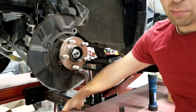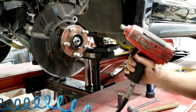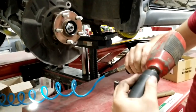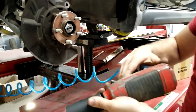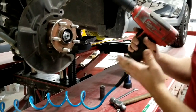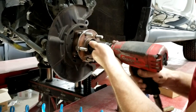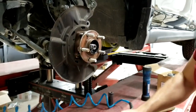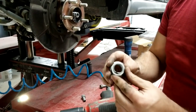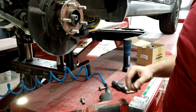If you have an impact it's nice. They make very nice electrical ones — this is an air impact made by Snap-on, but they make these nice new ones by Milwaukee. You can pick one up on Amazon inexpensively and it's battery powered — it makes your job a lot easier. You'll have to use a new axle nut because this is technically a one-time use: you have to bend the point to keep it from coming off.